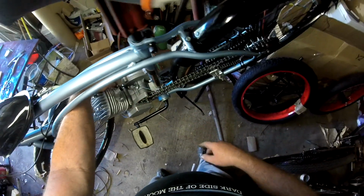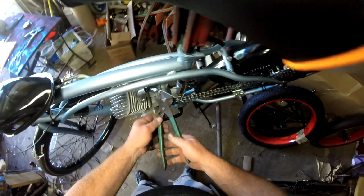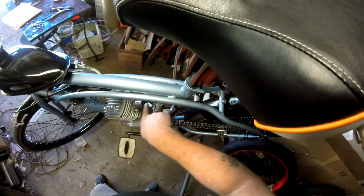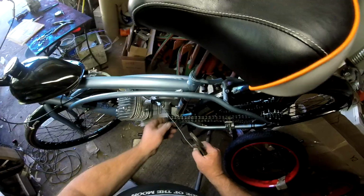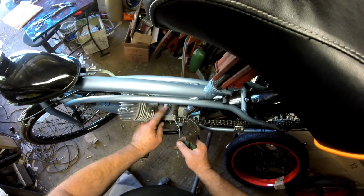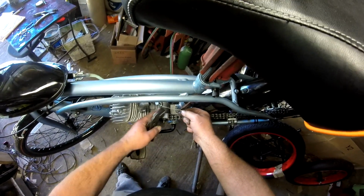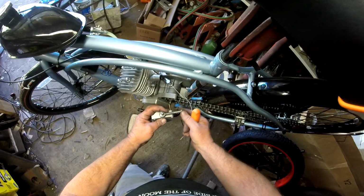Push the cable end into the holder here, get my spring to where it's just beyond the cylinder there. Use my channel locks. I want to give this just a little bit of a turn. It's a little bit hard to put the cable in if I have this turned the way I like it here. I turn it this way to lessen the angle where it's going to mount on the clutch arm. If I have it turned more this way, with this facing a little bit more backwards, the cable will have to come back around too much, and it'll put too much of a bind on the cable here. Okay, let's put our sprocket cover on.